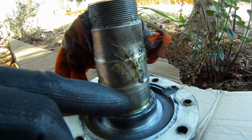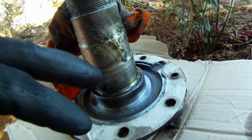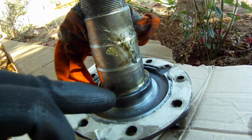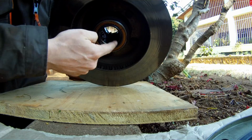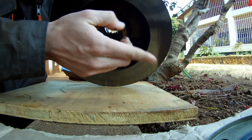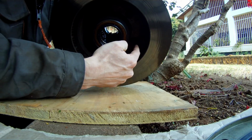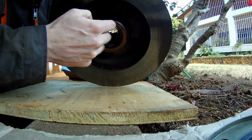I know you're going for stub axles and separate bearings, which is great. And I want both of those bearings to be the same size, unlike the Land Cruiser 70 series. I want to buy one set of bearings and know I have them all in stock. But I do want one of those hub seals for Land Cruisers from Terrain Tamer that's dual-lipped and you fit it flush in the hub. Unlike Defender, where you have to get the depth exactly right.